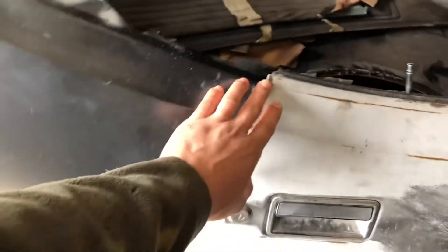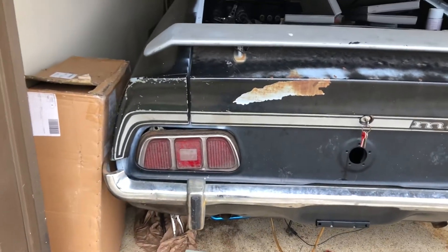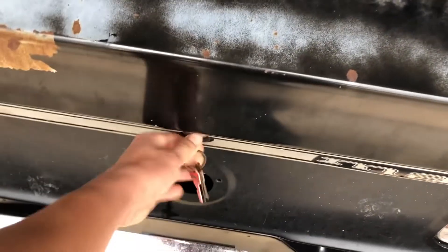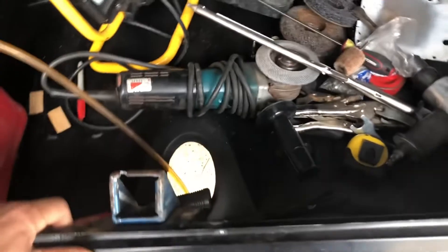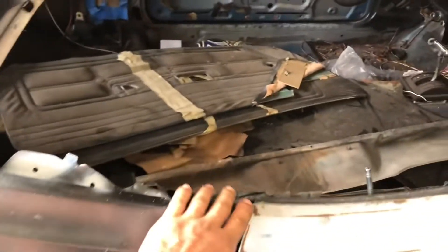The lines aren't really lined up, but it's coming along — there's still a little room for it to go up. I'm gonna mess with this for a little bit and then show you how it came out once everything is fitted. Working on the gaps — it's a little bit better, still some minor tweaking, but it's coming along pretty good. I got the trunk working; it's the only thing that I've welded. It just goes on this rear tail light panel piece — it doesn't get welded to the floor or anything, just weld it here, here, and then up here.